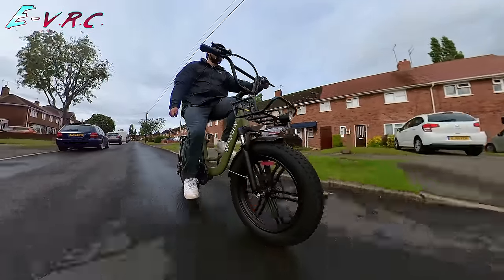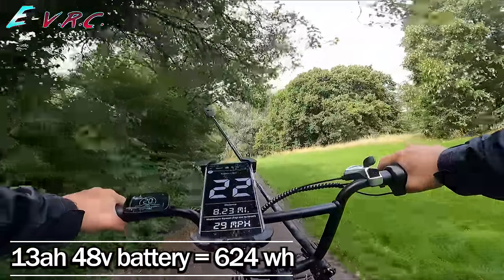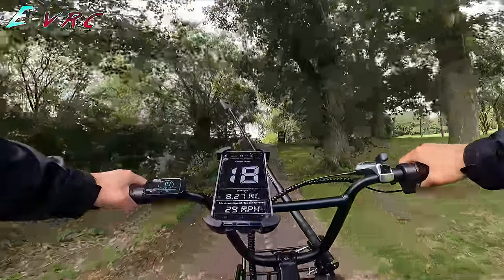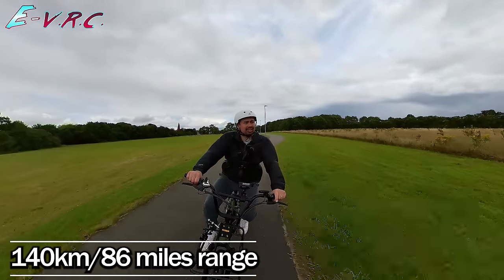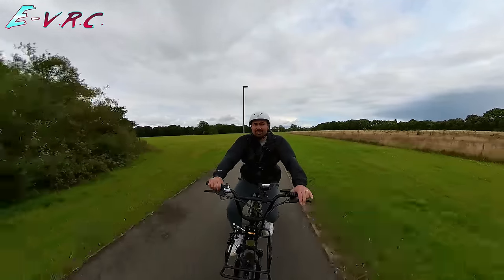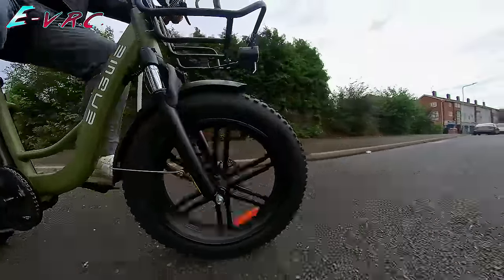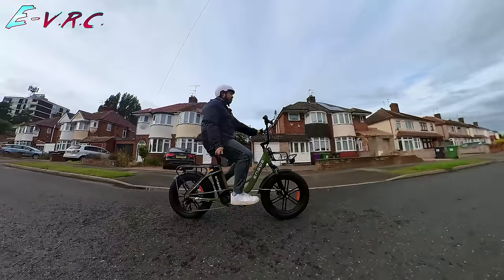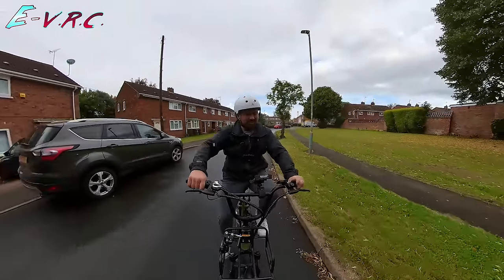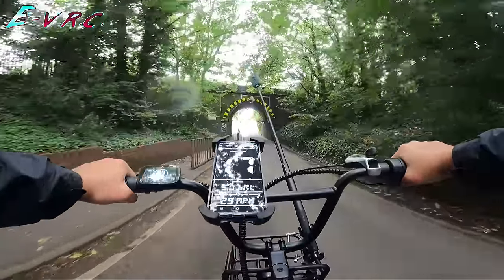Let's talk about that claimed range of 140 kilometers or about 86 miles. The 48 volt battery is 13 amp hours, giving it a capacity of 624 watt hours, which is a decent size. With full pedal assist 5 and liberal use of the throttle, I get about 22 to 23 miles of usable power. As the battery runs into the last bar, the speed doesn't drop drastically — it starts to cruise at about 22 miles per hour instead of 25. The 140 kilometer range is pretty much always in pedal assist 1, which looks like this — no one wants to be going that slow. Realistically, if you're willing to do most of the work, you can go 140 kilometers, but it's just not going to be very fun.